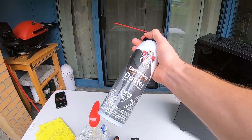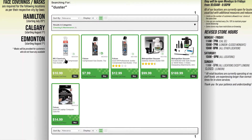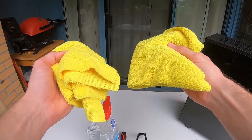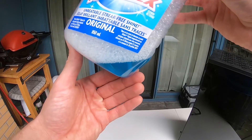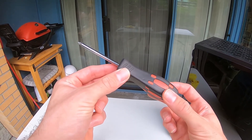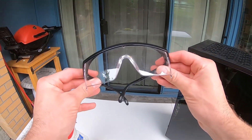So what you'll need is a source of air — an air can, an air compressor, or a purpose-built electronic duster. Some of those actually come with anti-static wrist straps and bristles. Most people will use a can, so that's what I'll use today. Microfiber cloths are excellent for getting rid of dust; paper towel will also do. For tighter spots, cotton swabs are what you need — keep a few of them handy. Get yourself some surface cleaner; I like to use window cleaner, which is especially good for tempered glass and side panels notorious for attracting fingerprints. Make sure you grab any tools you might need to remove parts — typically a Phillips head screwdriver is enough. Lastly, grab a mask and some safety glasses if you have them, as you don't want to breathe in the stuff that's built up in there.